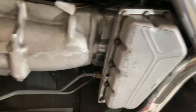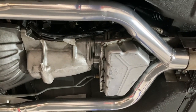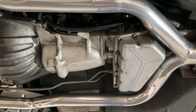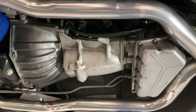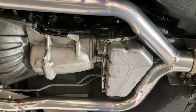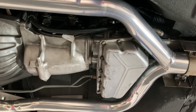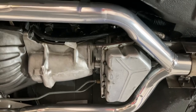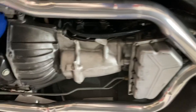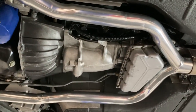If I remember right, it's basically the internals of a Turbo 350 for second and third gear on there. I have it set up with a switch so I can turn it off at any time. The way you drive a four-plus-three to go fast is: first, second, third, fourth, then you turn the overdrive on as you're going back to third and then fourth. So basically you've got one, two, three, four, five, six gears that way. You can still kick it down into second overdrive and have all sorts of different ratios — it's like a two-speed rear end basically.